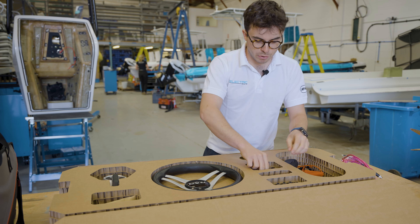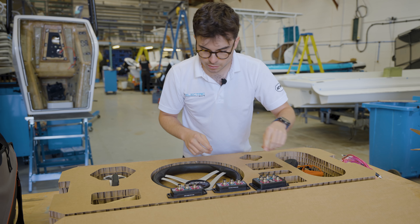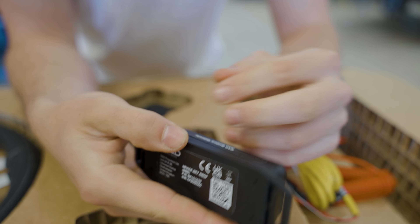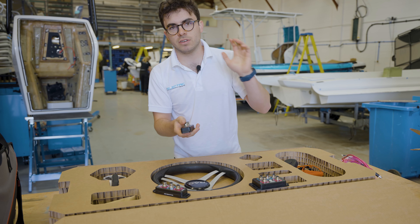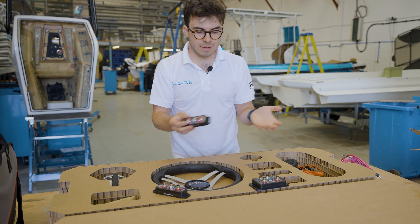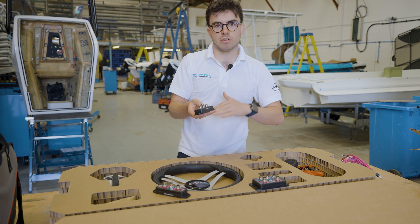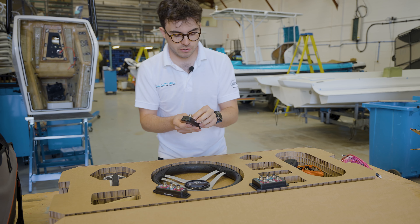We've got three different boxes in here. These do all of the communications with the RAD bus. So we've got the RAD battery gateway here — nice label on the side of it. This one takes all of the information from your battery and is able to display up onto the screen what state of charge you're at, the temperatures, any warnings that you need to know. It also works with throttling so if the battery is getting too low, it prevents you from over-discharging the battery.